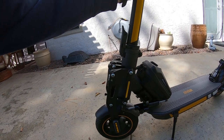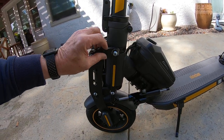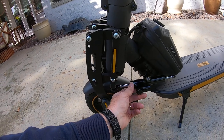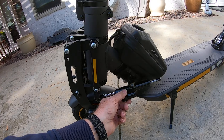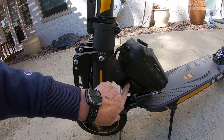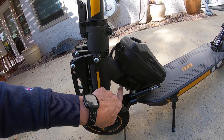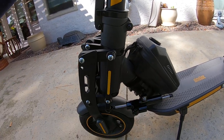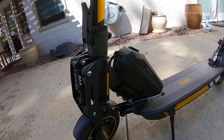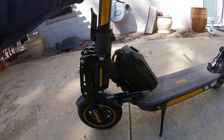I did a separate video on this steering damper setup — it works great with the mono rim suspension. I added this steel bar to hold the front of the steering damper. I got the damper off eBay for $35. It's adjustable so I can change the dampening strength. I made a steel plate with a mounting lug that I welded on, held to the frame with hose clamps, worm drive screws, and double-sided tape. I get full lock both ways and it works really nicely.